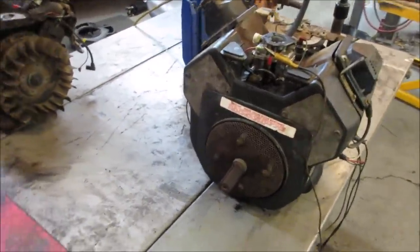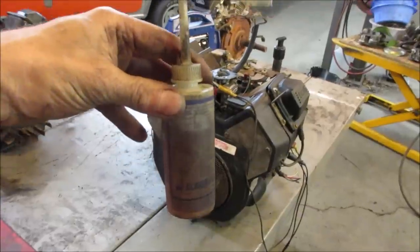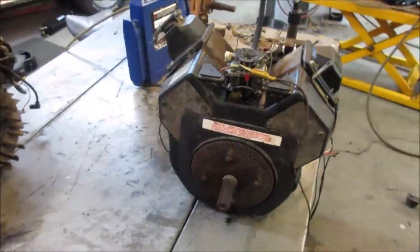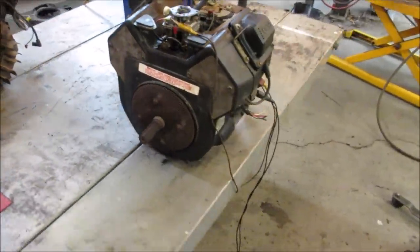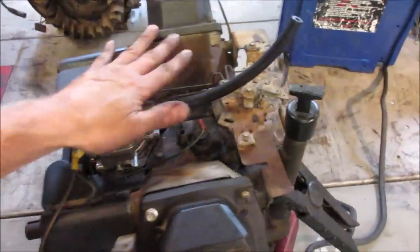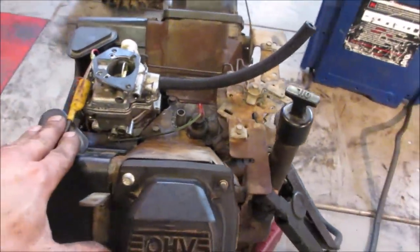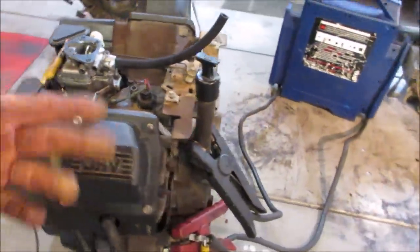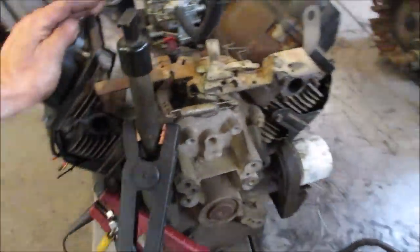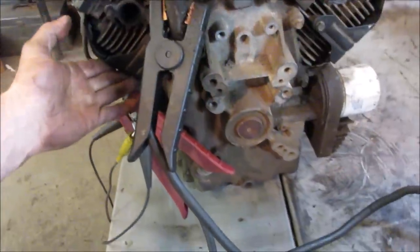About to say, there's literally a third of one of those in there. Not that much gas. Yeah, it seems decent, just fine. Again, the idle's a little low. Make sure the air cleaner's on. There's no air-fuel mix on that carb, I don't think. There's no way to tweak the idle, but again, it seems like it's just fine. All I'm concerned about is that we're running on two cylinders. It seems like it's doing what it should.